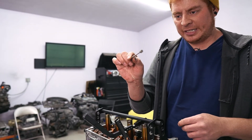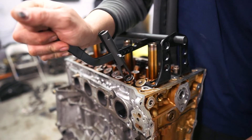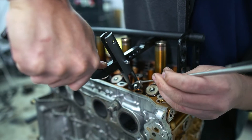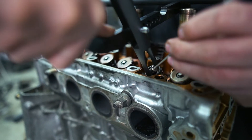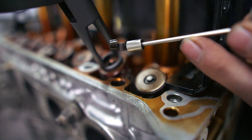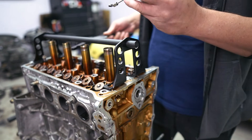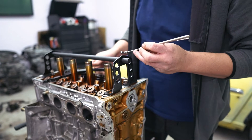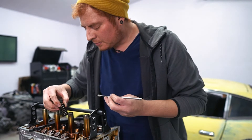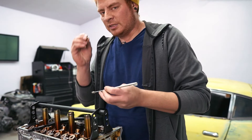I got a little pen magnet. I press down on the valve again — this thing's pretty hard to press down. There we go — we got our locks off the retainer. Now if I release, the whole spring is no longer attached to the valve. Now just repeat that six more times, and make sure not to lose these locks.